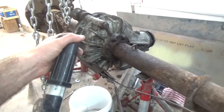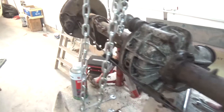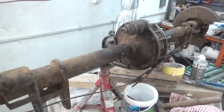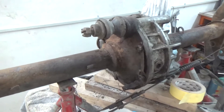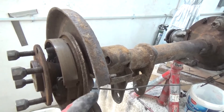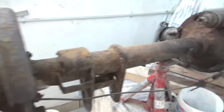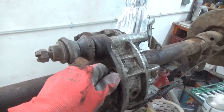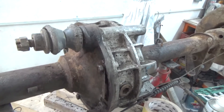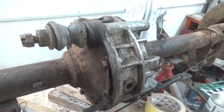After cleaning the main differential, we started taking some components apart, beginning with the hydraulic brake lines. As we're disassembling the axle, we're going in the following stages: we remove the brakes, discs, and the calipers, then disassemble the handbrake mechanism. Next, I started releasing the nuts that hold the axle together — at least they weren't too hard as there was grease. Just watch out for the locking tabs: flatten them first, then you can release the nuts.